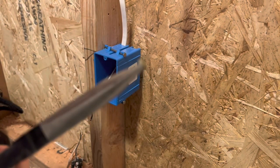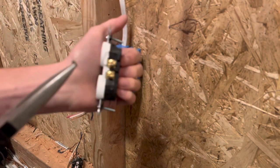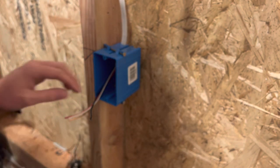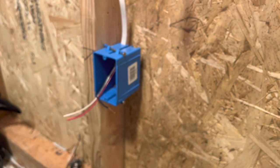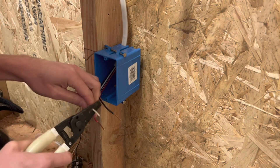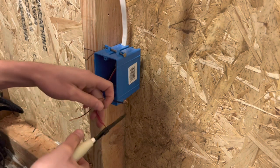Sometimes it can be tricky to break this tab off depending on the plug. I have it right here — rip the tab off. Now it is gone; you can see it in the middle of my pliers, so I got that torn off. Depending on which side you want switched, that's where you're going to put your switched wire. In this case, my black wire is my constant power, so the side I want constantly on is going to be on that side. I'm going to curl all these wires because I'm not going to stab them in the back.